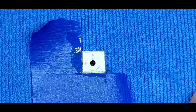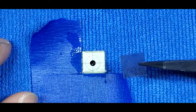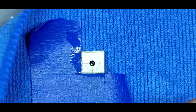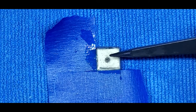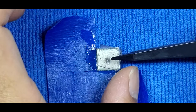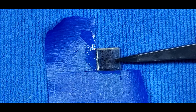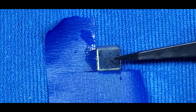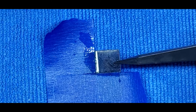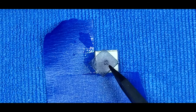Even though I'm going to throw that part away, let me show it to you. This thing that we just removed is called polarizing film. It looks pretty dirty because of the Goo Gone and the glue. That's a positive display. If I rotate this 90 degrees to the left, look what happens — we've got our negative display. Go back 90 degrees — positive. 90 degrees in the opposite direction — negative. So that's all you're doing: taking new polarizing film and orienting it 90 degrees to the left or right. However, the side that you're on is also going to be very important when putting on your film, and I'll explain that later.